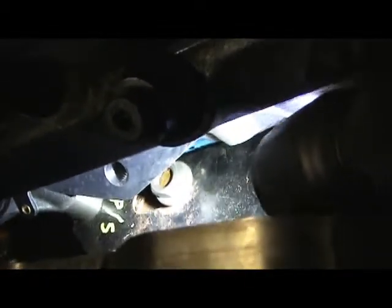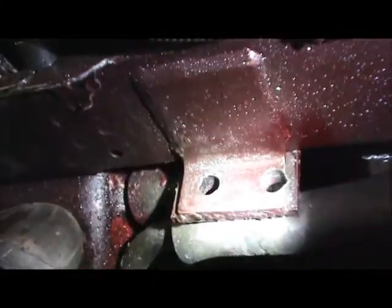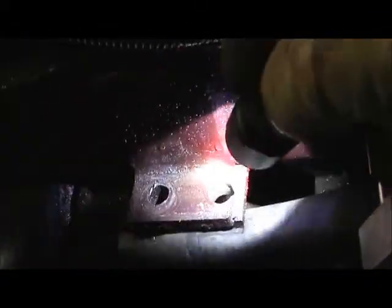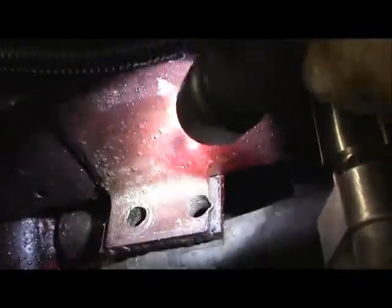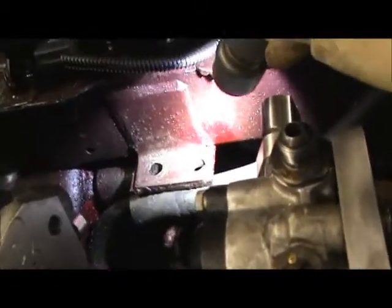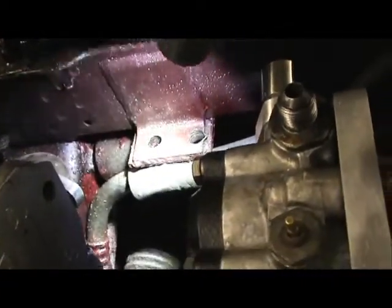And once that's where it needs to be, these front motor plates go on, and they get connected to the frame there. All right, you see that or not? There's a quarter inch stainless steel plate welded on the bottom of the car. And there's another quarter inch stainless steel angle iron welded to this part of the car. The motor plates go from the head here to that flat plate and that angle iron I welded to the body to keep the motor from rocking back and forth.